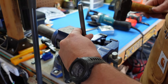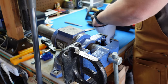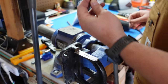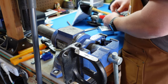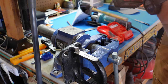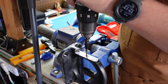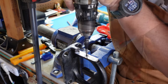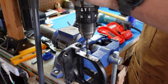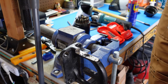I'm using a center hole punch just to make sure I don't wobble too much, then the bolt I'm trying to get through there. I think that's a quarter inch, so I'm going to hit this with one of my skinny step-down bits. I've overestimated the thickness for the step-down bit. I don't like just slamming through these — then you've got a broken bit.